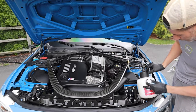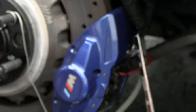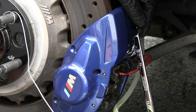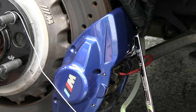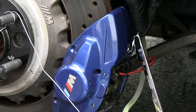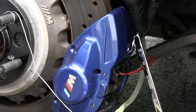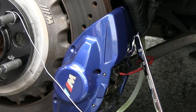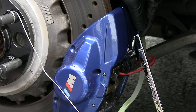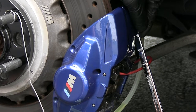This is right at 15 PSI. I'll periodically come back and check to make sure it's still there. All right, here we go — fluid is starting to come through. As I understand it, I'm going to wait until we see no bubbles, which there are a ton of right now. We're going to wait until this is free-flowing, the right color — meaning the same color as the brake fluid we put in — and that there are no air bubbles.